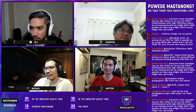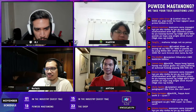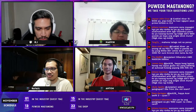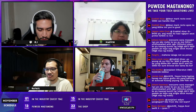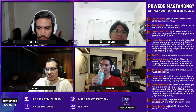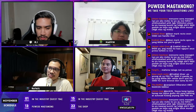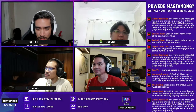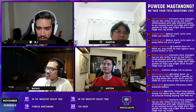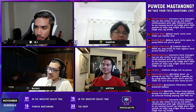So you really do have to check if your setup, basically all your connections, wireless, wired, works straight up to one modem. And then you can build from there. You can put a repeater if you just need to extend it. You can buy another router if you really need more bandwidth to reach other spaces. But start small. If it's just you gaming and nobody else in your place, just go straight up router wired and you won't have an issue.